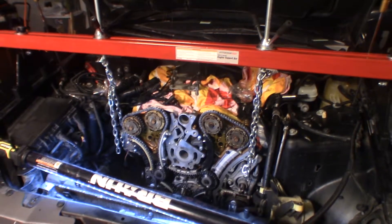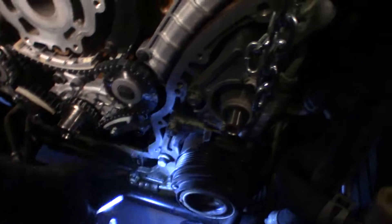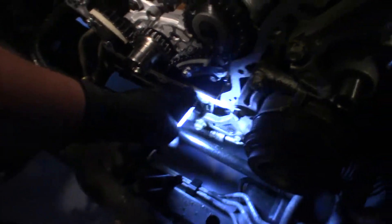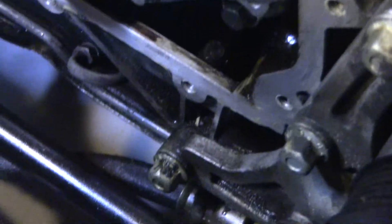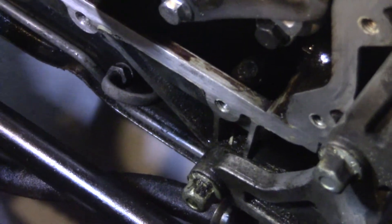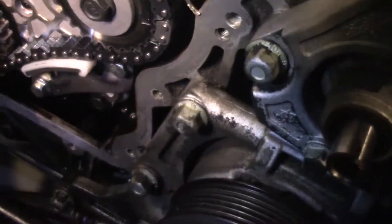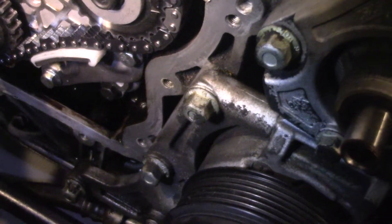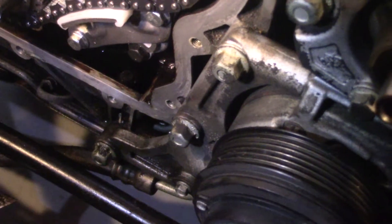Now we'll work from the bottom side of the car and start making room. The shop manual says we need to remove the AC bracket on the AC compressor. There's one bolt right there that's hooked to the face of the oil pan, so that for sure has to come out. I'm going to just pull that one bolt and see how much trouble we have removing the pan, leaving the rest of the AC bracket intact — but it may be necessary to get access to the side bolts by that AC compressor.